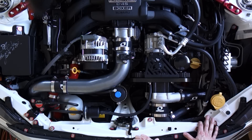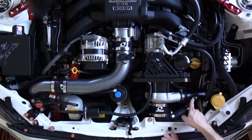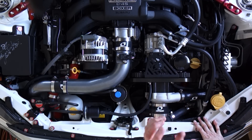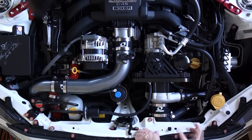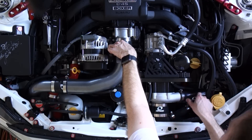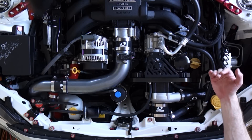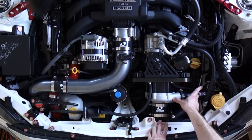The way we can combat this is with a hybrid style blow-off valve. What that does is it lets some of the air out to atmosphere - just a little bit, enough to give you that whoosh sound - but then it vents all the rest of that air back into the intake where it can be measured. Because it's already been measured, it's running back into the intake, so there's a lot more air in the system and it's much more closely matched to what the engine management system thinks is inside the car. To recap: the air is being compressed, it hits the butterfly valve, if the pressure on the intake side of the blow-off valve is greater than the manifold pressure the valve opens and vents either to atmosphere or back into the intake, and then as soon as that pressure differential swaps back the valve closes.